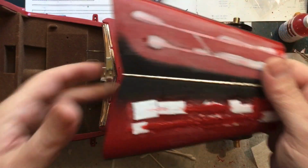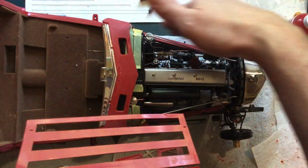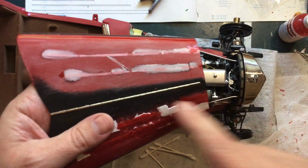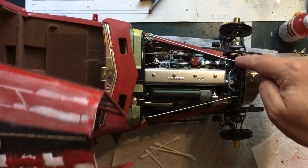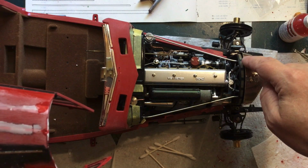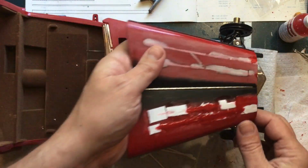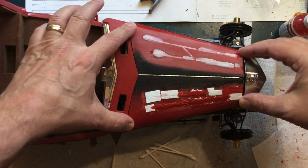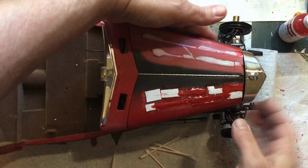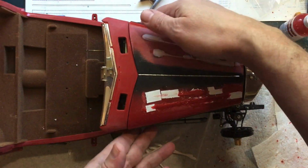So when I very first started fitting the hood panels, I even said that the sides fit almost perfect. And cutting the slits here got this edge here down to match the curve here pretty much perfect. So the hood panels now fit pretty much perfect. The side panels fit pretty much perfect. But yet when they're all connected, when I push the hood panels down in place, the side panels push out. When I push the side panels in place, the hood pops up.